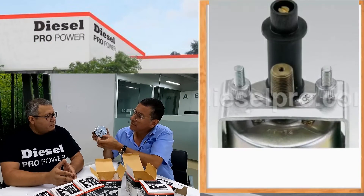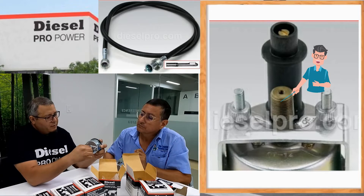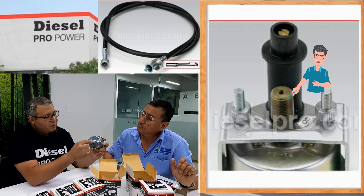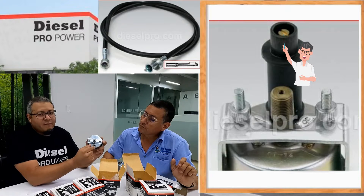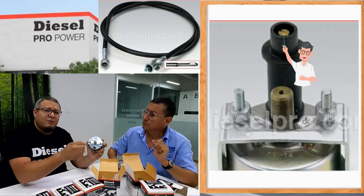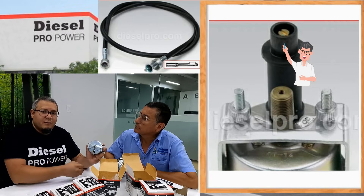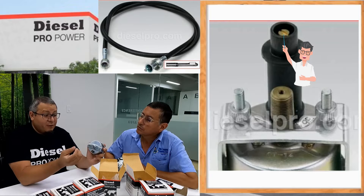This is the mechanical, and on the back it has the connection for the cable. As you can see, it has the 1/8 NPT where you can connect the mechanical tachometer cable, and the mechanical gauge will read the RPMs through the cable. It also has this little screw — a connection for the light bulb. You can connect a light bulb here so you can see at night. Sometimes the engine runs on the flying bridge when people are out fishing or commercial fishing — they need lights so they can read the engines at night.